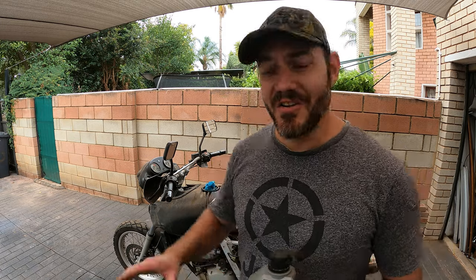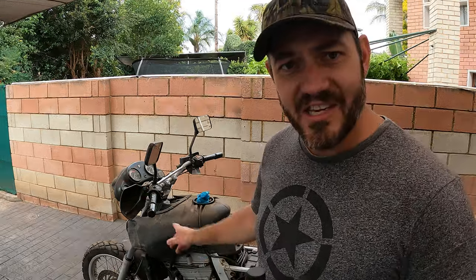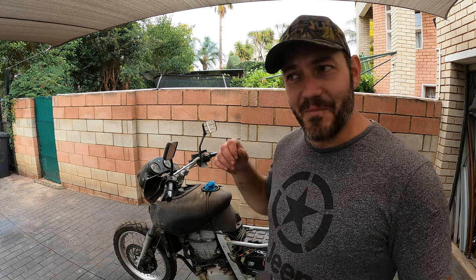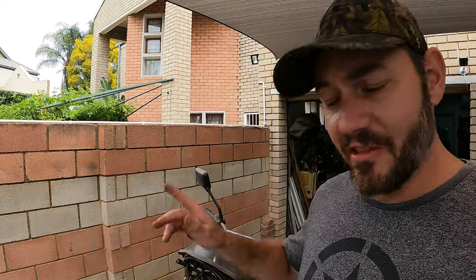You've seen this BMW F650 in previous videos. This bike has a blown head gasket — that's why we went a bit quiet on it. I still have to order the parts; I forgot about it a little, it was standing in the back. I first need to drain the oil and all the coolant as well, because they mixed — that's how I know it's got a blown head gasket, or the head could be cracked.